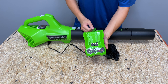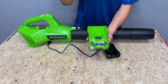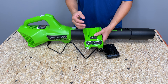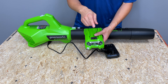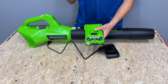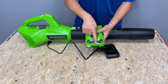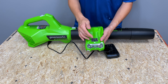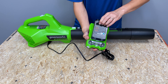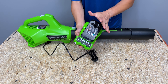Here is the charger that comes with the Greenworks kit — it's their 24-volt lithium charger, which charges all their 24-volt batteries regardless of amp-hour rating. It has two LED indicator lights: solid red means the battery is too hot and waiting to cool down; blinking red means the battery is no good and should be replaced; blinking green means it's charging; and solid green means it's charged and ready to go. The battery slides in and out pretty easily without having to unclip it, which is standard for most power tool battery chargers.